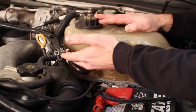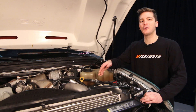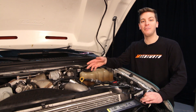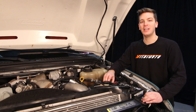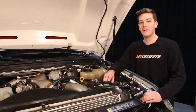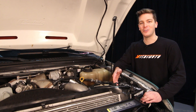Also, we want to make sure we have the correct Venturi T installed. Next, we want to check out the coolant hoses. Ford issued a TSB updating the engine side of your upper and lower hose with a white connector and a double o-ring design. This is to help prevent air pockets from entering your cooling system. We highly recommend that you install the Mishimoto silicone coolant hose kit because we have the double o-ring design on both the engine side and the radiator side.